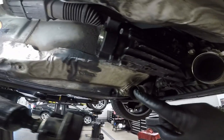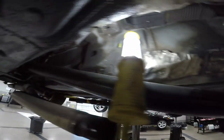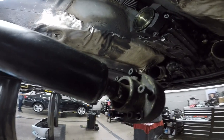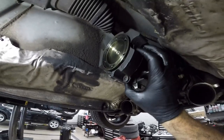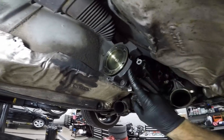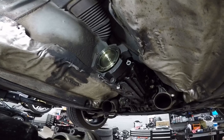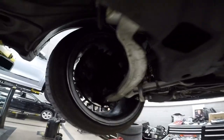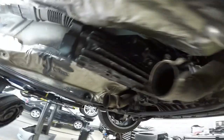First off I pulled the downpipes — took both off — then I loosened the center prop shaft. This is a one-piece shaft I had made a few years back by a local drive shaft shop and it's holding up really really good. It's balanced well, hardly any vibration. Next we're going to drain the fluid, then pull the tail housing off with the Torsen, remove the Torsen from it, put in the new welded one, and put it back in. We'll get new fluid filled up, get it all back together, then swap out the axles — both front axles coming out and the stub axles going in.